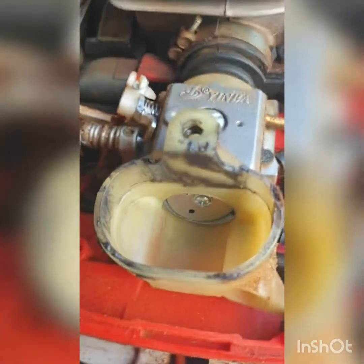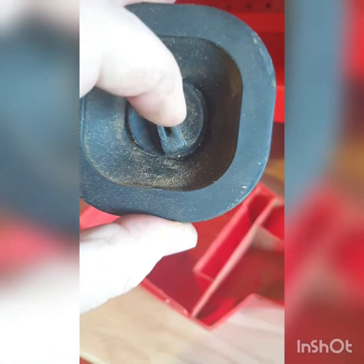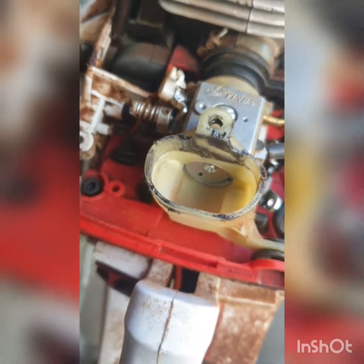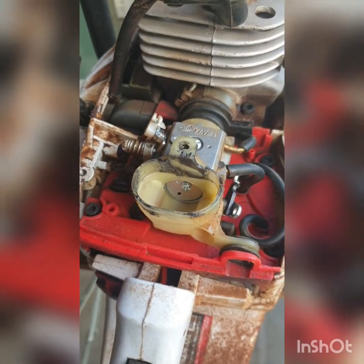Let's clean it all up and get inside. I'll quickly point out — always grease. You can see where I put the grease on the actual air filter itself, and also underneath this nut. It catches it all. You can see it's had quite a bit of use — a big weekend actually — still nice and clean inside. So use any grease; it catches it all and it does keep it clean.